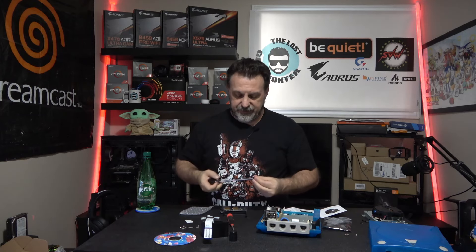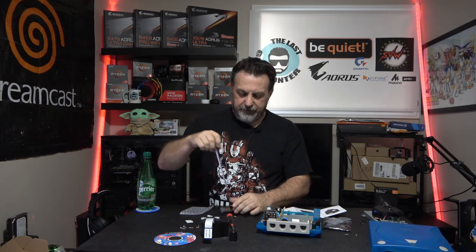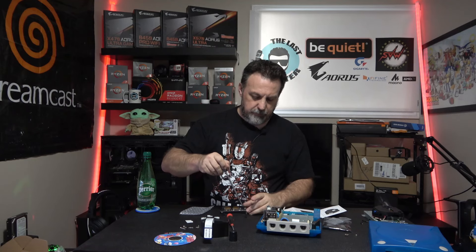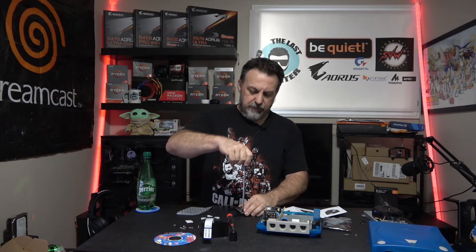The 3D print quality on this is absolutely phenomenal — I'm very very impressed. Don't tighten screws all the way until you get everything aligned; just make it snug and don't over-tighten it, because it was warping and actually pulling when I was trying to put this together.